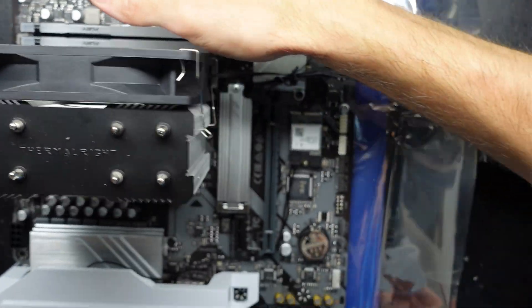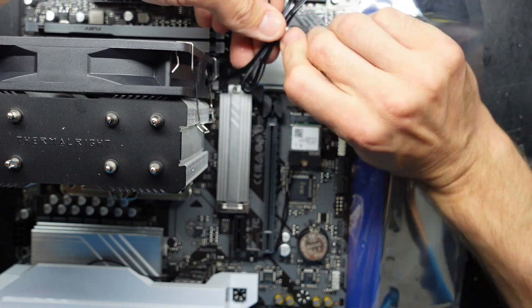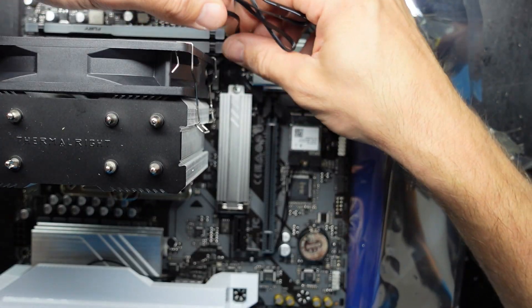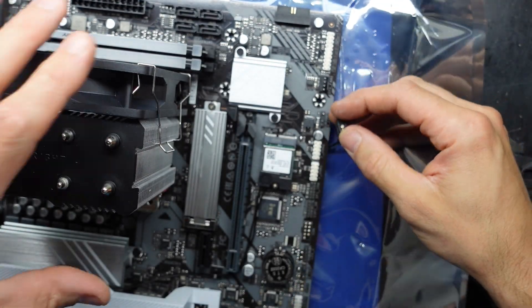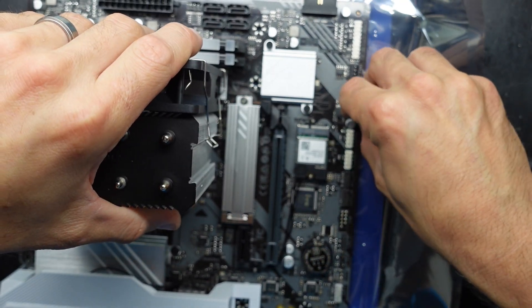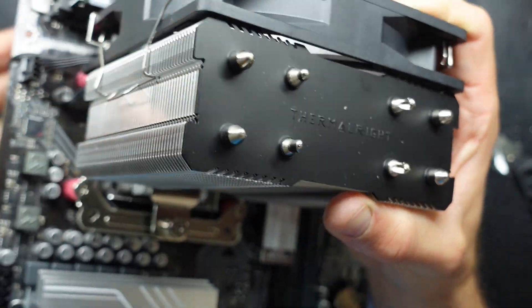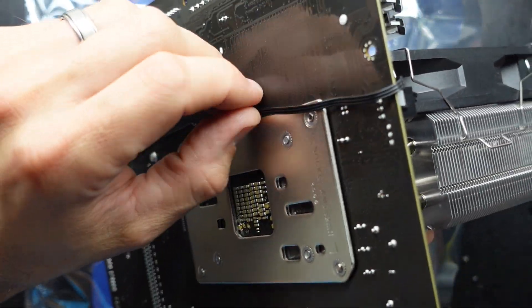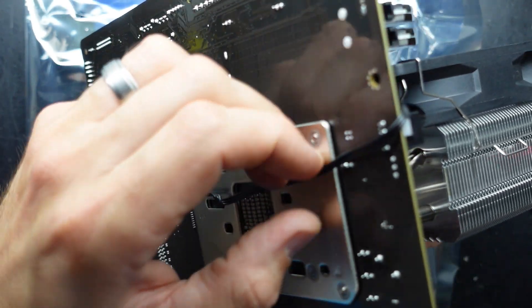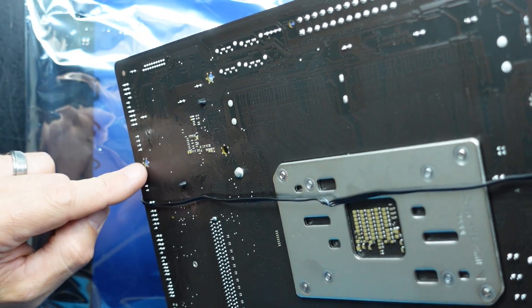Next up I could probably still run this cable up the top — there's plenty of length. I wonder if I can do the tricky of running it underneath and behind the board and back up, and then just plug in down the bottom here. In this particular instance there's enough cord on the fan header to snake it around the back of the board. I just have to be careful not to have it too close to the motherboard screws — like here, here, and here — just so I don't pinch it.